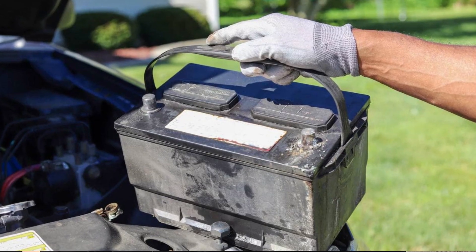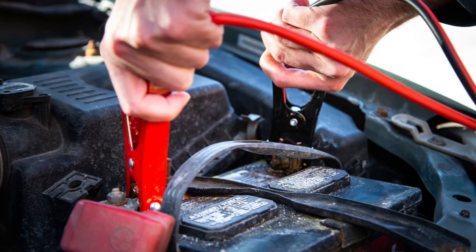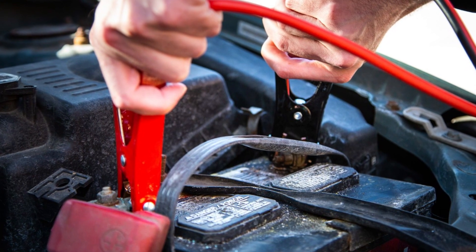There are several reasons why you may see this error message. One of the most obvious reasons is a battery problem. The 12V battery suddenly dropped its voltage, and the brain of your car understands that it may not start the engine automatically. The confirmation of this is that when you start your engine manually, you may hear unusual sounds as if the rotation of the engine is lazier than usual. In this case, turning off the start stop feature may save you from getting stranded after several start stop cycles. Charging or replacing the 12V battery is the proper solution.